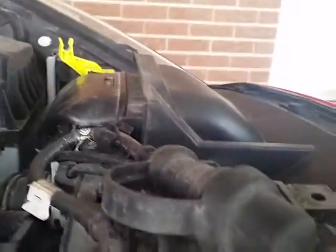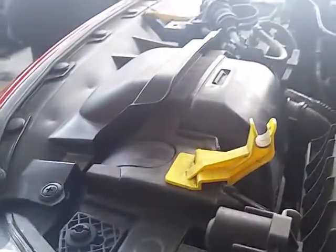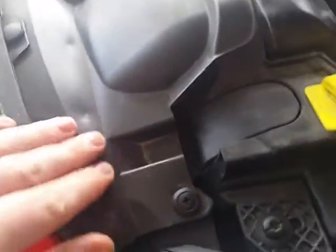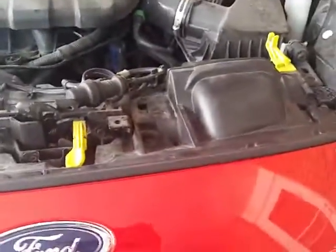So this is what we're talking about with the no extra required cutting. As you can see, the OEM cowl looks pretty good, matched up to somebody else's. You might be able to tell it's a little bit higher, but otherwise that is what they're talking about. When you reinstall the bumper, if you leave this on, like I did, you're either going to get this one to go or you're not, and if not, then you can bring it down with heat. You can see a couple little divots here once I had heated and pressed down, and that's about the only difference between that and stock.